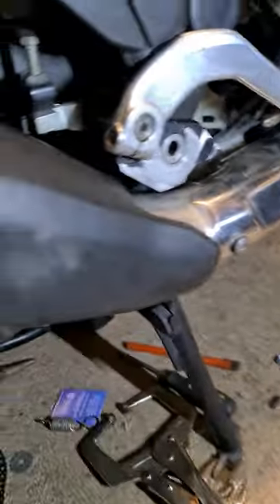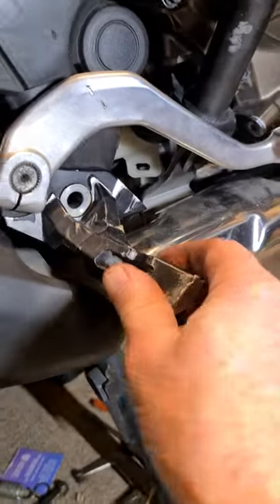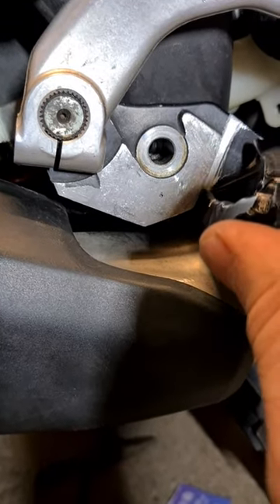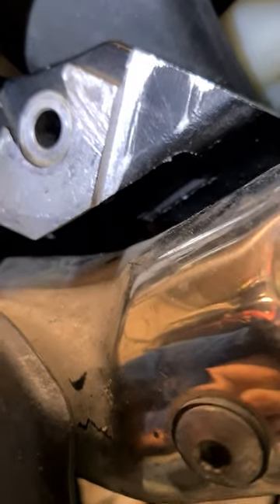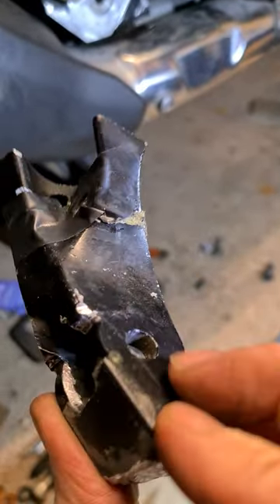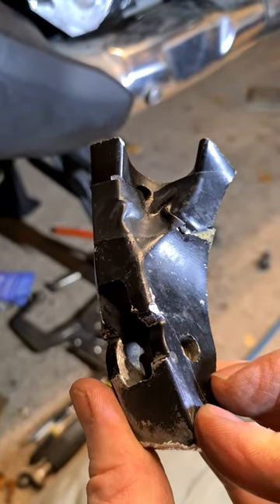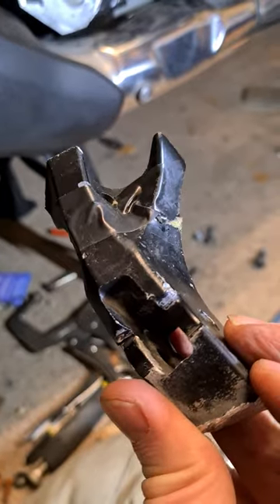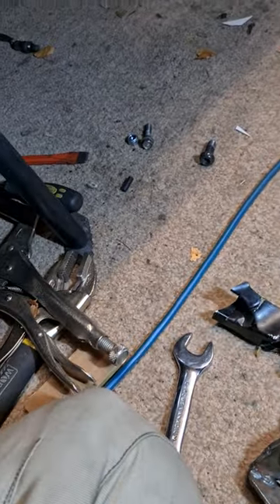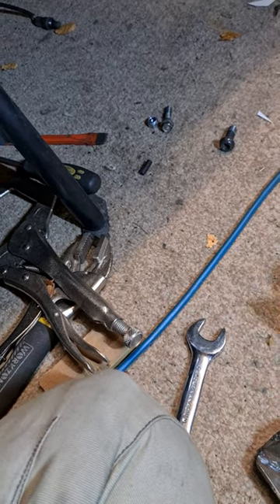I thought, I know what I'll do — I'll make it out of mild steel. Obviously it didn't break like that; I've sawn it off and cut a chamfer in there. That's about a three-mil step. It's really interesting the way they've made this — it's very light. The two prongs we're looking at now, in normal use when you're stood on the peg, that's its orientation.